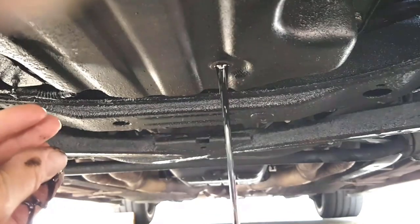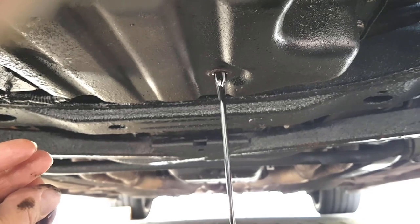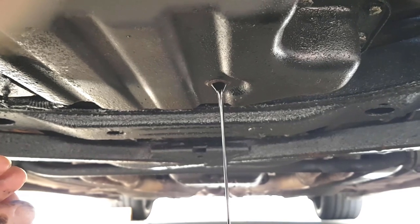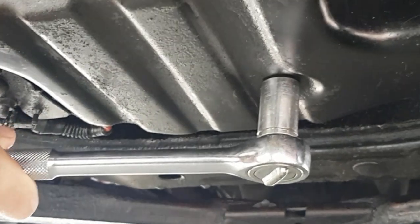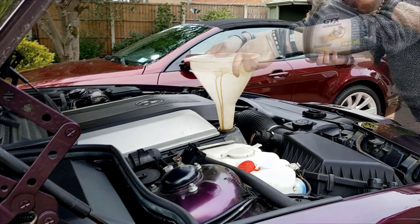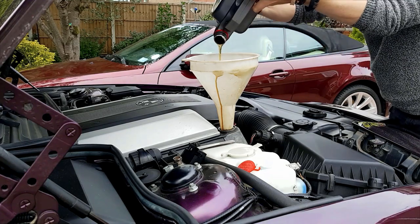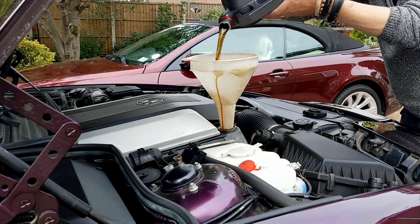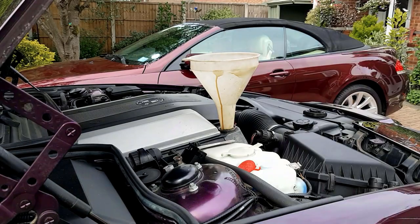There was about a pint left in, so I won't use that pump again — a pint of oil is just too much to leave behind. Put the new copper ring on the drain plug, and once it's all drained out, refit it. You don't need much pressure — don't strip the threads, just a slight heave on a one-foot wrench. Then new oil in: eight liters. I never measure it — I just pour in eight liters and it stays like that until the next oil change a year later. Never have to top up. That's the new packaging for the GTX.